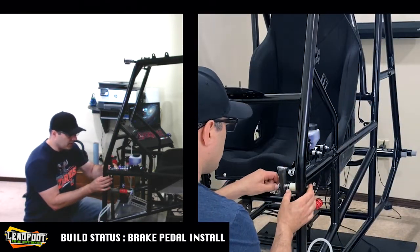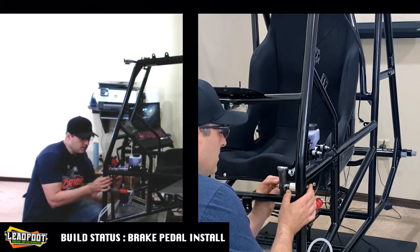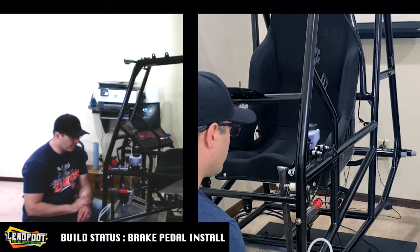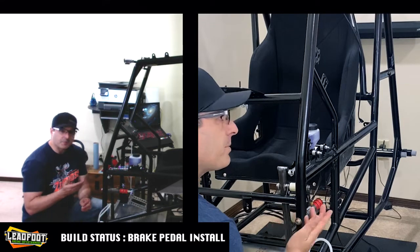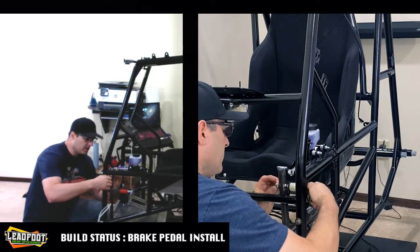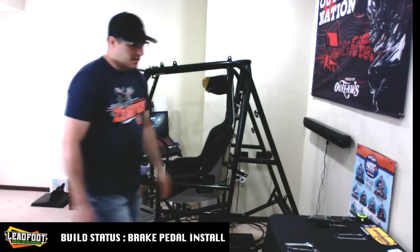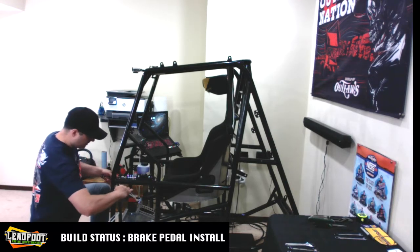And on the other side, we're going to line it with another acrylic flat washer and a standard metal 3/8 washer. I'm going to do that so there's free movement as I depress the brake pedal. I don't want any binding going on, so my solution to accomplish that is to add these plastic washers in here. And then we'll put in our 3/8 lock nut. And we'll go ahead and tighten this down. We're going to require, I believe it's the 9/16 wrenches for this. It is.